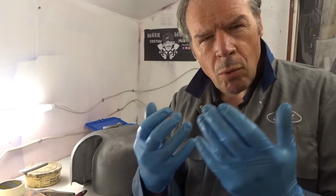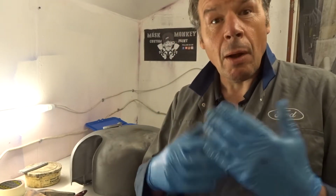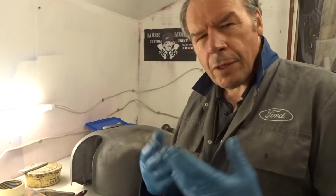They pulled most of that dent out, and now we've just got to get the right contours and a nice surface so that we can apply our 2K primer. So first of all, we're going to do some lead loading. How long has it been? It's been quite some time. I recently revisited the lead loading on the Ferrari, that's a long-term project. But before that, it must be 25 years since I've done lead loading, and it's like riding a bike.